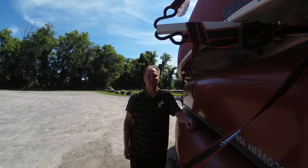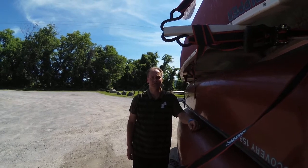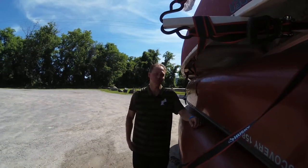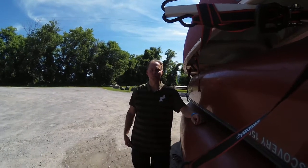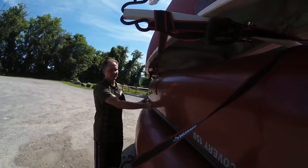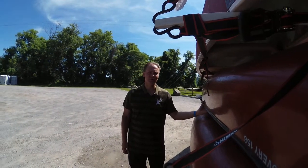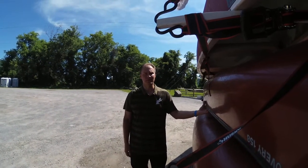I'm going to talk to you today about how to latch down the canoes to the canoe carrier. Very important: you don't want canoes to fall off. Before you leave, give a tug on the canoe, make sure it's not going to come off. Check all the canoes before you start moving with your trailer.